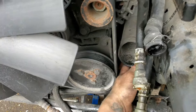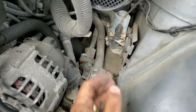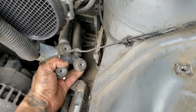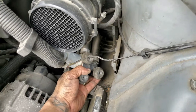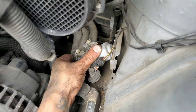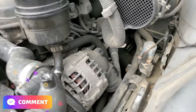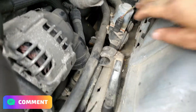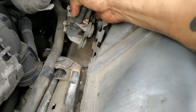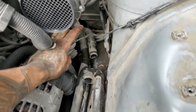I'm gonna take out this little alternator cooling duct and put that aside for later. One of the last things is this coolant component - the bottom one needs to come off because the bottom side is connected to the engine. The sensor and the top one can stay. There's a hose clamp right in there. If anybody wants to do a heater core delete, hit me up in the comments - this is a component you can actually use when you delete your heater core.